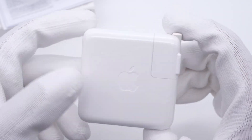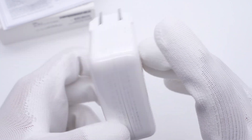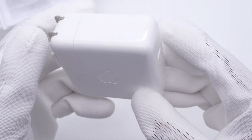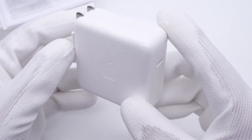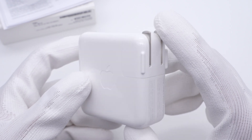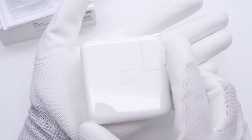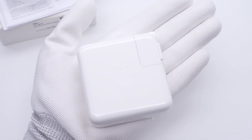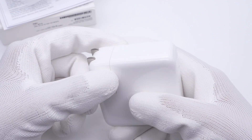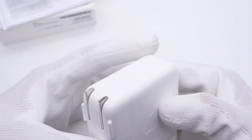That's all the tests for this brand new 70W GaN charger from Apple. It's specifically designed for laptops and tablets, and is slightly smaller than the previous 67W charger due to its internal GaN components. Our tests revealed that the charging speed has not significantly improved compared to the previous generation. However, its standby power consumption and conversion efficiency are at top-tier levels, and the ripple and temperature are also well controlled. Don't forget to like, leave your comments, and subscribe. See you in the next video!